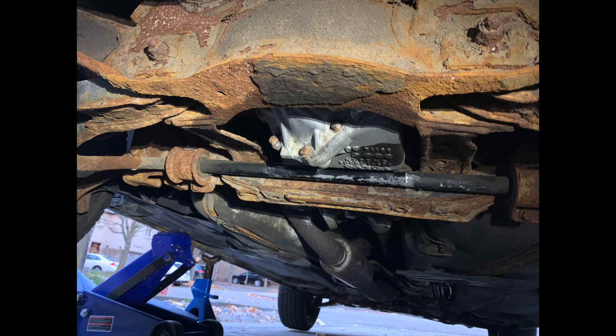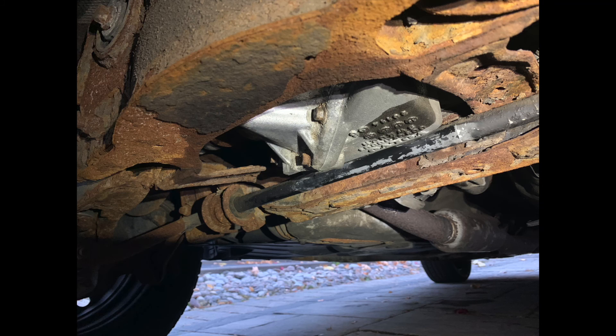This photo is after about three days of driving. I came back and jacked it up — you can see where that leak is; that's on the passenger side of the diff, so the axle seal on that side is leaking. I also want to note that even before this happened, when I was underneath the car and physically looked at the axle seal with a flashlight through all that tight space, I could see tears in the actual axle seal. This next photo is from a few days later after another three or four days of driving including a good amount of highway driving, and the only place that was leaking was coming right from the passenger rear axle seal.